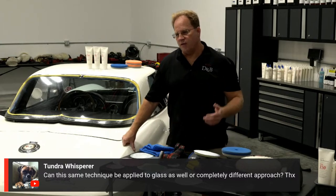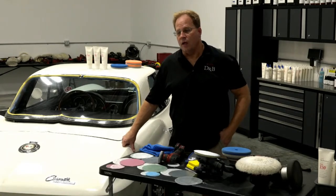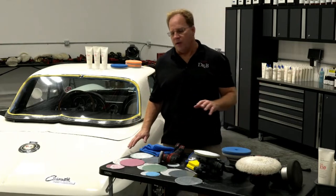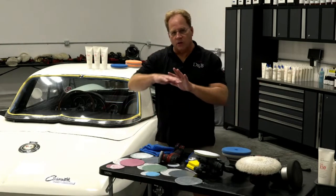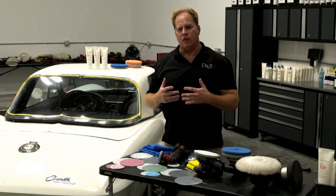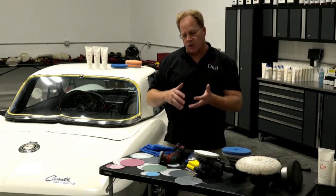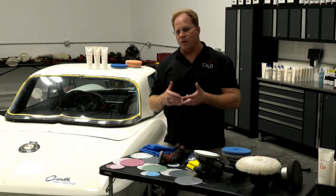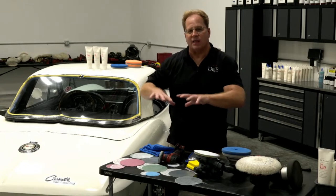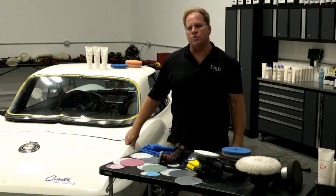And the ones I've done in the past, I've started out with either 180 grit or 360 grit. But the hardest part about sanding glass, the whole thing is hard, there's nothing easy about it, is breaking through the glaze. When you look at a piece of glass, it's very smooth, and you gotta break through that. It's only the really low grits that'll do that. Once you break through, future grits, so 360, 500, 1000, 2000, 3000, 4000, however high you wanna go, can bite that surface because you broke through it. But it's a very long, arduous process.